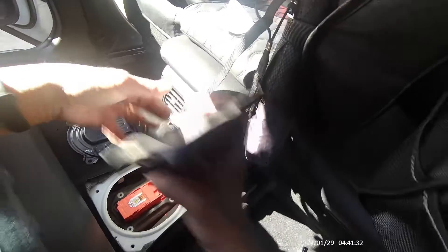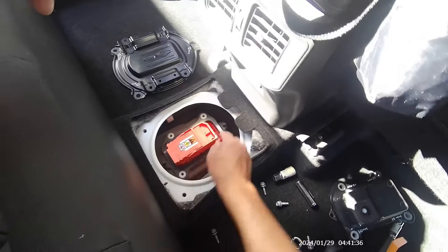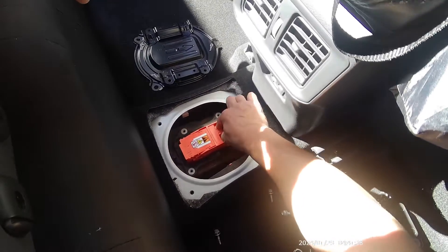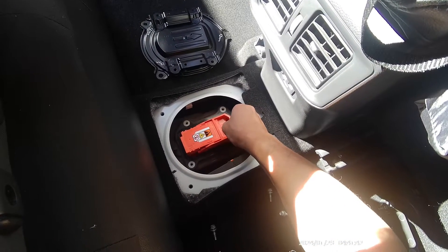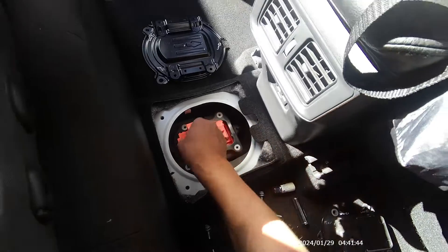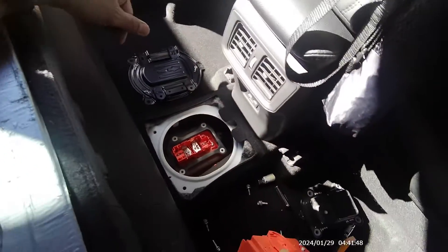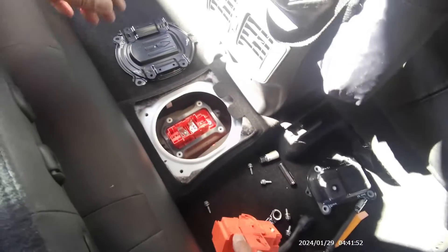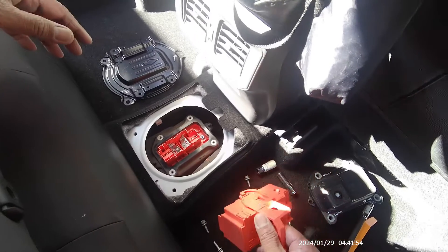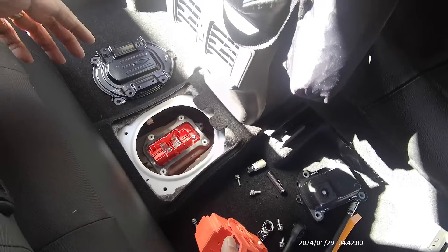All right, don't forget that. So there's the hybrid plug — as you can see, it's right there. All you have to do is pull forward and then up like that, and there it is — it's disconnected. Now you can service your vehicle, or the mechanic can work on it without danger, hopefully without getting electrocuted.